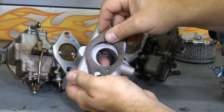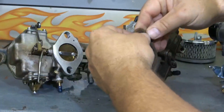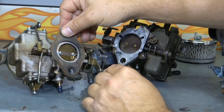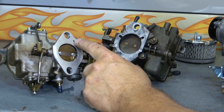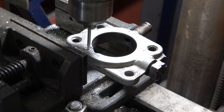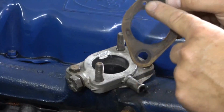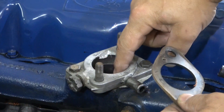What if I take the smaller carburetor and put it on the bigger opening? When the fuel and air come into the engine it'll expand a little bit, and I can make accommodations for the idle mixture hole through the gasket and through the spacer. I marked the spacer with a regular gasket to estimate where the hole should be, then milled out a slot on the drill press to allow the air to go through. Then I took the gasket, marked the hole location, and drilled through it. Now I have a hole in the gasket that lines up with the bottom of the carburetor and a slot in the spacer to let air into the manifold for the idle adjustment.